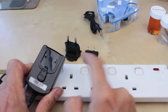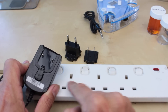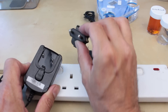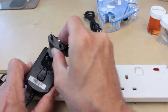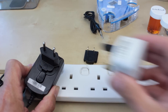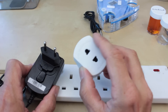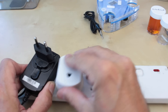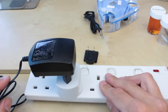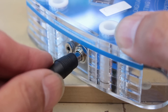The power adapter works with 110 to 220 volts, so it's suitable for the USA and Europe, and it comes with two interchangeable plugs. Here in the UK we have square plugs, so you'll need to use the euro adapter and then get yourself one of these European shaver adapters — plug that in and you can use the euro plugs. That'll work absolutely fine in the UK.